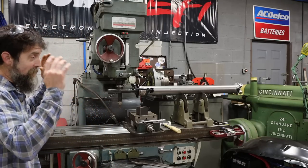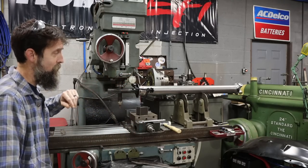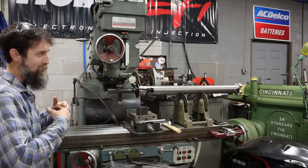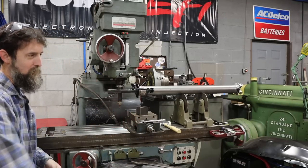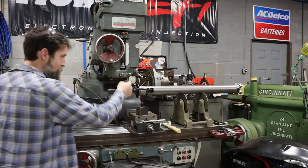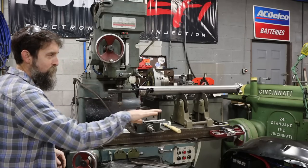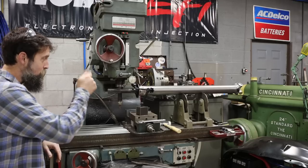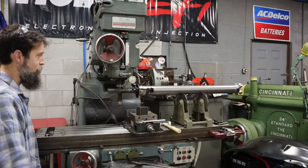But in the past, out of necessity, because it's kind of expensive to have one of these cut and remade, I've done most of them out in the driveway, gravel, slice and dice wheel on an angle grinder, put a piece of tape around them, cut the weld, air hammer off the section, drive them back together, roll them on top of a 55-gallon drum to see if you got any run out, and adjust it with a hammer if you do, weld them back together, and you're off to the races.